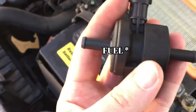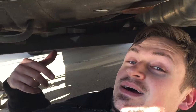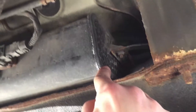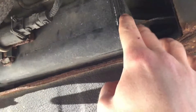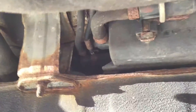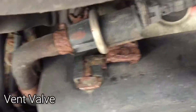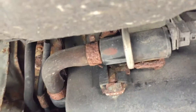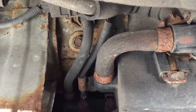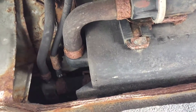Here we are under the vehicle. You've got your fuel tank right here, and right above the fuel tank we've got our charcoal canister, which filters out some of that gas-air mixture before it goes back to be burned in the engine. This is the valve I was talking about right here — whatever bracket was there already rusted through. What's common on these cars and many others is that these hoses get cracks in them and aren't functioning properly, which could be a common issue.